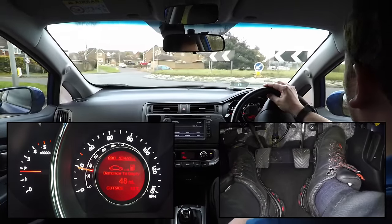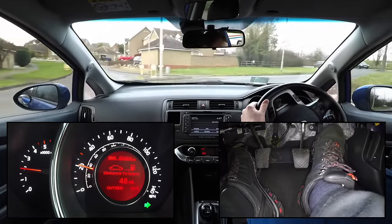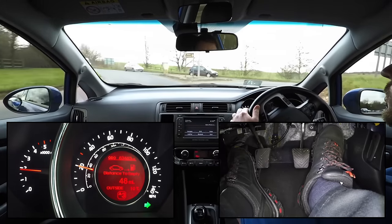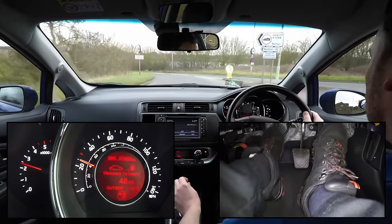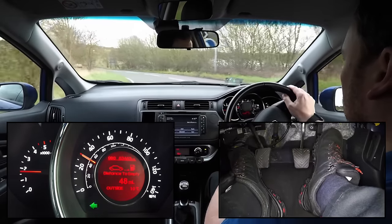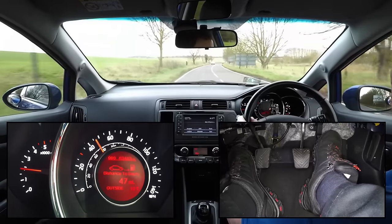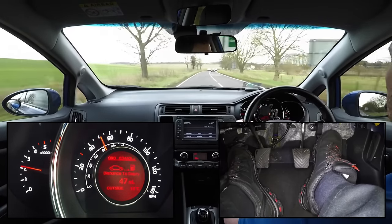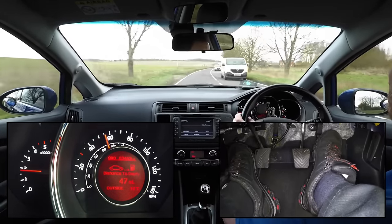This will take some time to master, as the amount of extra engine revs needed will vary depending on the car speed and gear being selected. The bigger the difference between the engine speed and road speed, the more extra engine revs will be needed. We try to allow ourselves plenty of time to complete the gear change, so plan well ahead and don't rush anything.